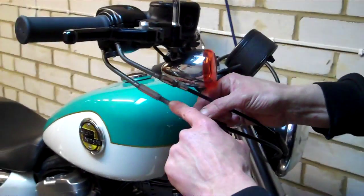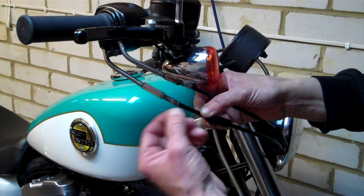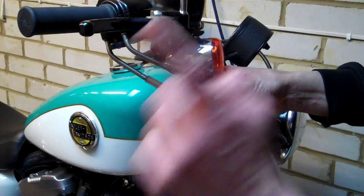Don't ever lubricate these — they don't need lubrication. The wire cable inside these days is all plastic coated. If you put oil down there it gathers dust, that makes a gunky substance, and that sticks it worse.